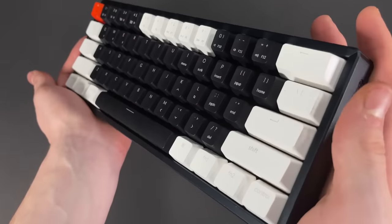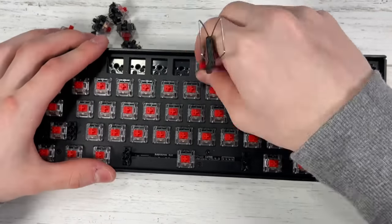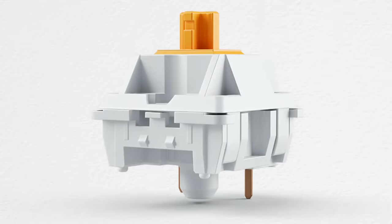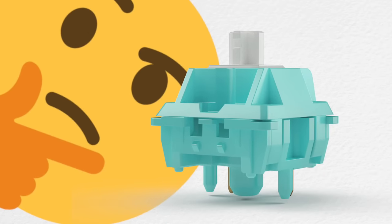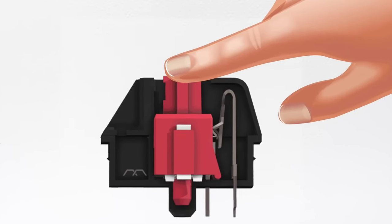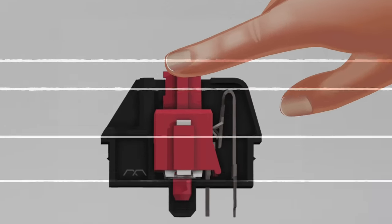The perfect custom keyboard for this mod will be the Keychron K12 — a fully wireless hot swap mechanical keyboard with only around 61 switches. After taking apart the keyboard and looking at everything inside, I started noticing some things. Pretty much every single keyboard switch in existence has this weird little indent. It actually serves a very simple purpose: whenever you press a switch down, the plunger portion of the switch extends beyond the switch itself to give you that extra post-travel.